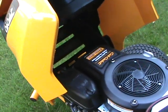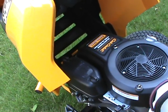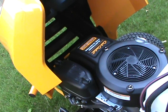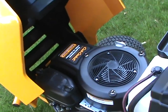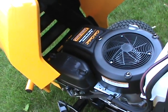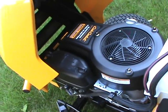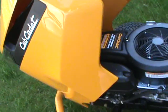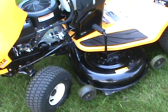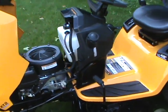This one is a 547cc and I don't know the exact horsepower rating. My former tractor was a Sears with a Briggs & Stratton 21-horse at 540cc, so thinking the bore and stroke are about the same, I figure this is around 21 horsepower — 20 horse anyway. The first time I used this was in April and the grass was about a foot long, and it went right through it with no bogging down. So it has plenty of power.